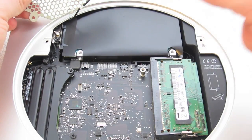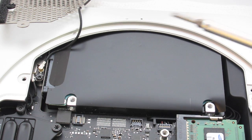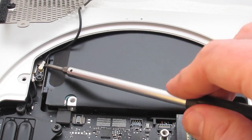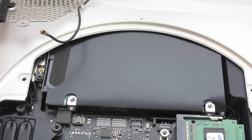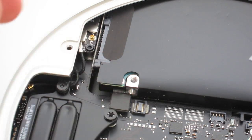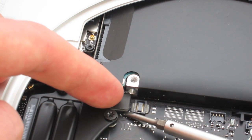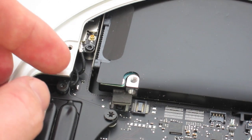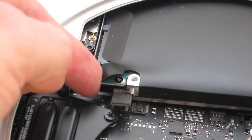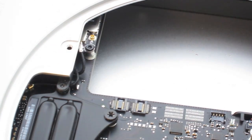Pull forward this cable. I like to use a small screwdriver and gently pop that out. This here is the cable connection port, so we're going to pop that up. That allows us to gently pull out the hard drive, revealing some empty space.